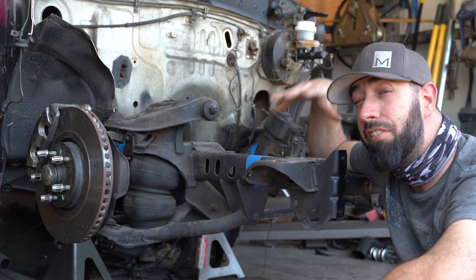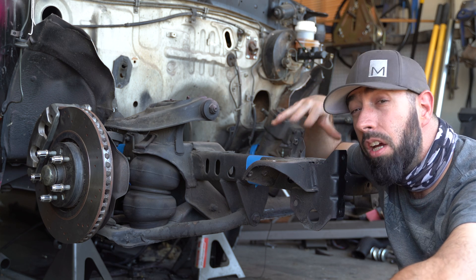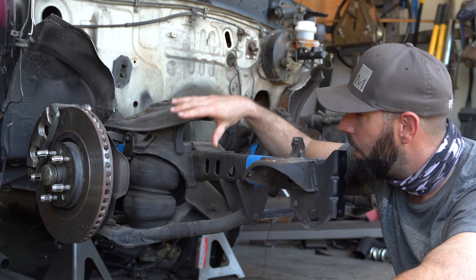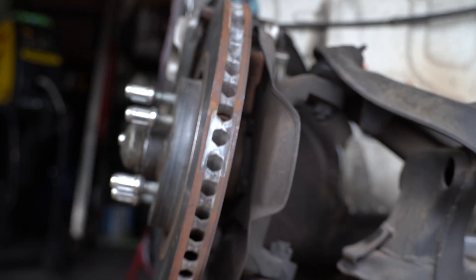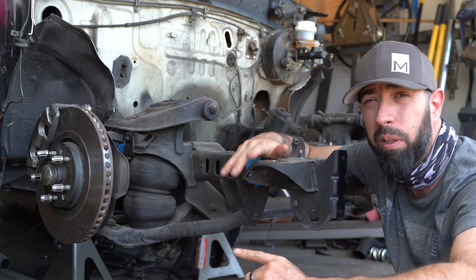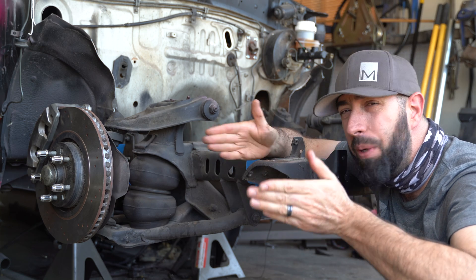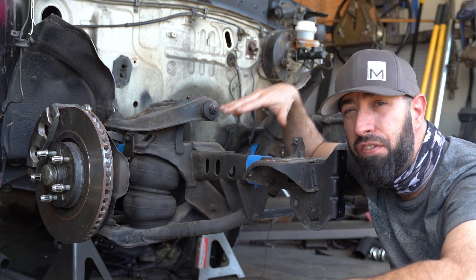The reason is the suspension on production vehicles is already optimized at their stock ride height — not so much for racing, but for safety, drivability, and tire wear. When we drop a vehicle using lowering springs or airbags, the factory geometry is getting pushed into positions it was never designed to be in. Then we start seeing side effects like extreme camber, excessive toe, and bump steer. If you've spent any time around vehicles with adjustable suspension, you've probably seen front tires toe in and out as they go up and down. This can be drastically minimized just by doing a frame Z.